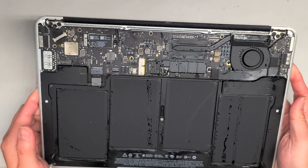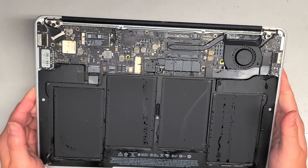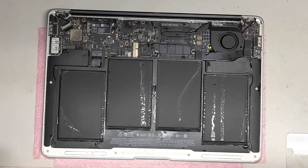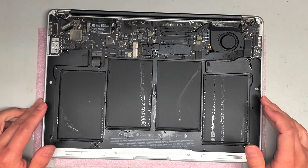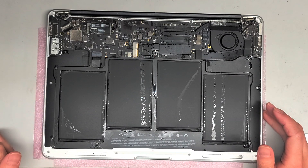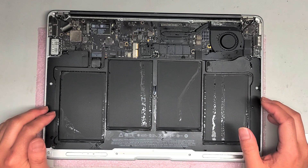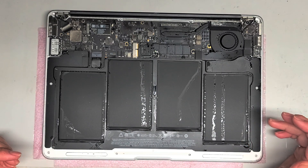I'm gonna contact the customer and see what they want to do. Hopefully this video was useful — at least if not in the video itself, maybe it'll help you find my other videos where I take apart these MacBook Airs. Usually if you get liquid spills, you want to take it completely apart and dry it all up before you even try plugging it in, and disconnect the battery as soon as possible. Thank you for watching — I'll see you in the next one.